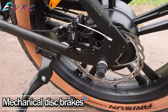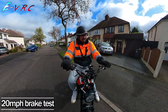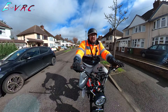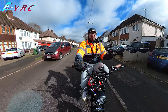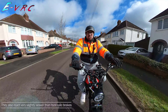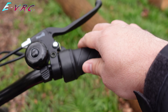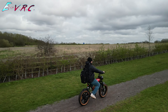Mechanical disc brakes — so nothing special. The thing about mechanical disc brakes is you're doing all the work, you've got to pull them yourself. So if you can pull hard enough that the brake doesn't slip on the wheel, they're all about as good as each other — then it just depends on your tyres. The combination of the fat tyres, which are pretty grippy with road tread, and yanking down as hard as I can on the brakes — they're not that bad. It's just a twist and go and don't worry about anything else kind of bike. However, I still think you should have hydraulic brakes on any e-bike that goes above 20 miles per hour.